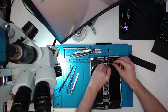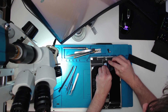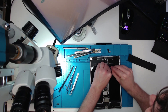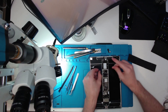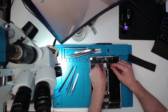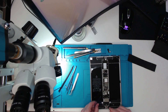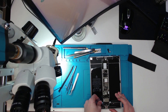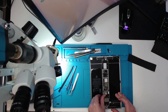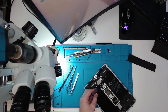From there, what I like to do is grab one of my prying cards — not metal, because it's not ideal to pry at a logic board — and I'll literally just work around the board to get rid of that adhesive holding it down. I'll hit it from the other end if I can. Just got to find a good entry point — there we go, start working along here. Careful of the battery terminal.